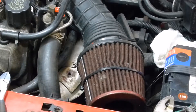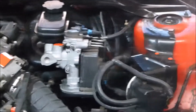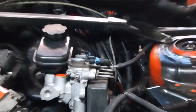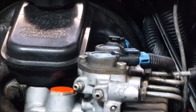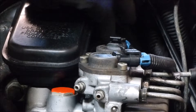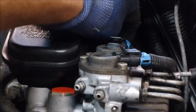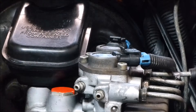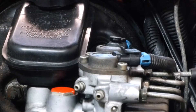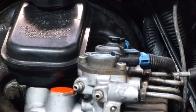One less little rattle, and we're going to put this baby outside. Right here — this is the power booster, and this is the vacuum vent or valve — sorry, I don't know the proper name — but the seal in the back of it is leaking badly. So I'm losing a lot of vacuum, and the brake pedal is working like 50 percent because of this vacuum leak.